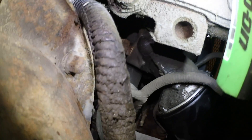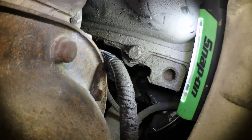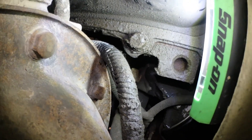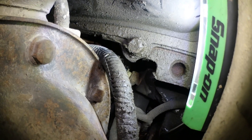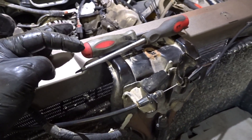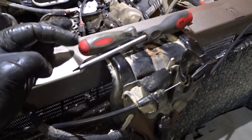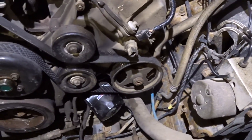There's your oil pressure switch up in there. I'm not going to be able to reach it from the bottom - no way I'm gonna get my hands up anywhere. Gonna have to try from the top. I used two long screwdrivers - carefully went one up to push the tab in and one from the front to bust it free gently. Then I was able to reach my hand in there and slide it off. Now I'm gonna pull that wiring harness up.